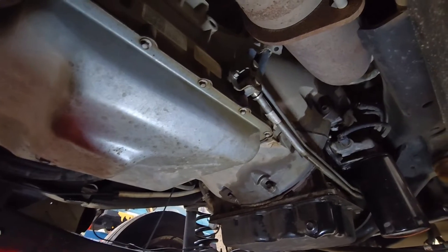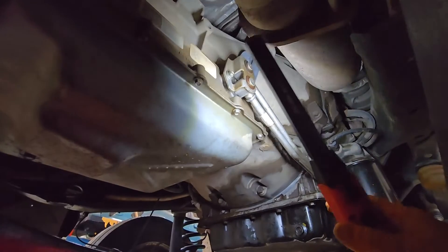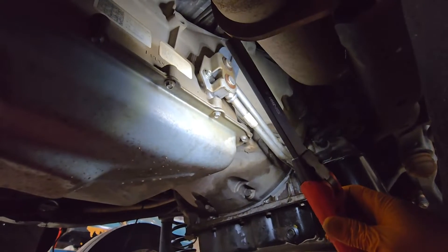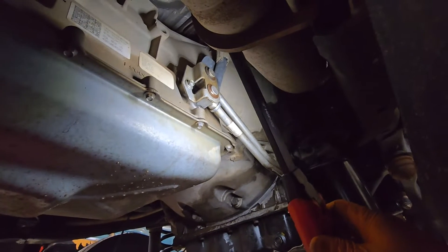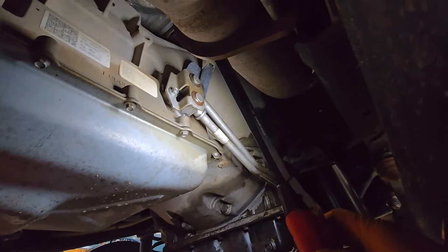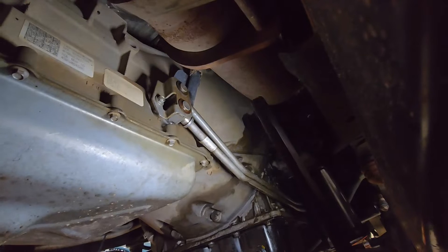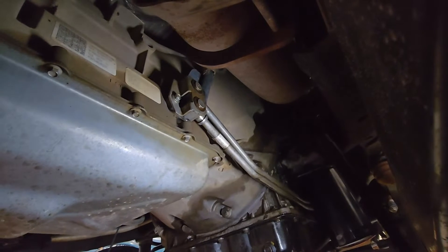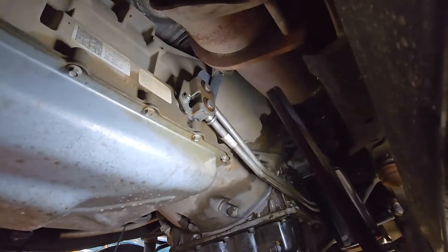For this part, you're going to need a five gallon bucket. These are the tranny cooler lines. We'll take that 10 millimeter bolt out and then wiggle back and forth — kind of pry against the lines — and they'll pop out. I'm going to drain those lines and the trans cooler. I drained the transmission last time and put all new fluid in it, so I'm going to try to keep the fluid because at 12, 13 bucks a quart, that stuff's not cheap. I tried this last week and found that you have to pull the engine in order to get this off.